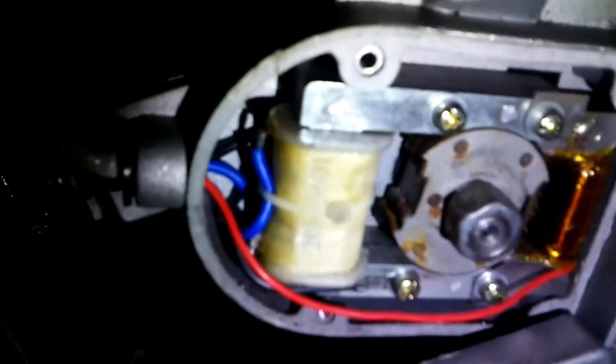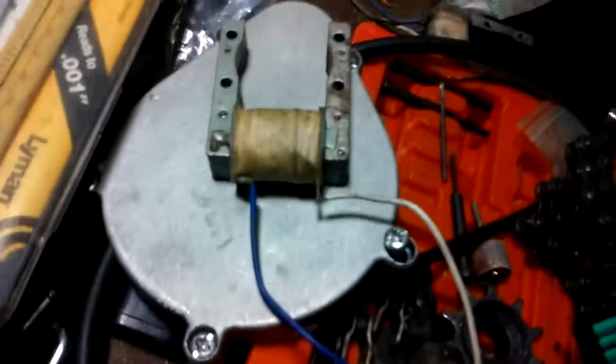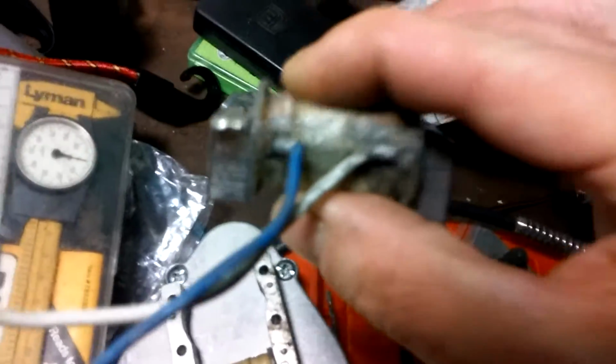They're failures. They are failures. They're known for failing. I've got a couple of them here. Look. White wire magneto. See that? Look at how flimsy that wire is. Look at that. Not only that, I'll tell you something else about these white wire magnetos. If you've ever noticed, these wires are not zip tied down to the magneto core. They're not zip tied down.